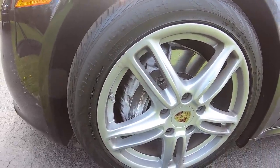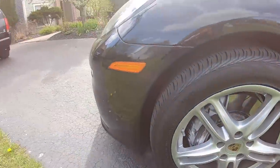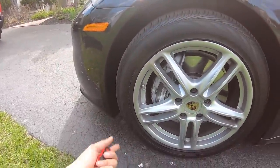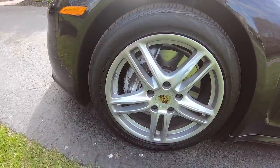They actually have the Porsche stencil, so we have to lay the stencil and paint over it — a little bit more tricky than just a sticker. With my CTSV Brembo brakes that I did with the Nismo color scheme, it was just black with a Nismo sticker — I painted them black, laid the sticker on top, then clear coated over all of it and it came out really good. For this one we'll toss some white paint on it, mask the whole thing off, and paint that one little bit.